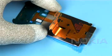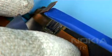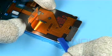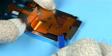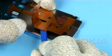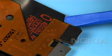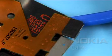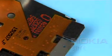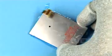Place the assembly on the face of the LCD. Use the SS93 for opening the flex connector. Do not apply pressure at the components underneath. Release the adhesive pads of the top flex assembly beginning at this edge. Also release the other shown pads. Keep these adhesives clean if this part should be used again. Remove the adhesive residues on the opponent part.